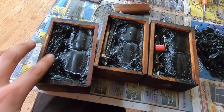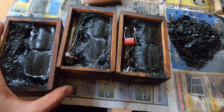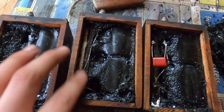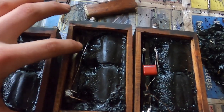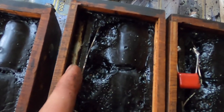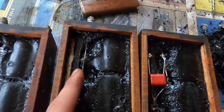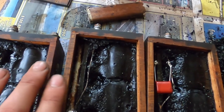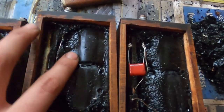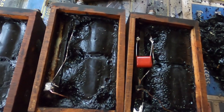On this side is where the capacitor is, so you have to chip out the tar just on this side. You chip out the tar on that side and then you can access the capacitor. There's a piece of glass right next to the capacitor that separates it from the rest of the coil parts. You just want to chip on top of the glass and to the left — you don't want to get anywhere to the right because you can get into the windings. If you nick the windings, they short out and the whole coil doesn't work.